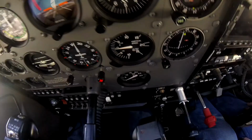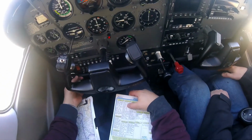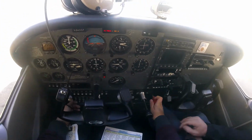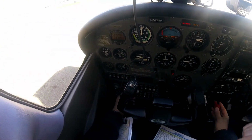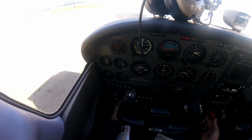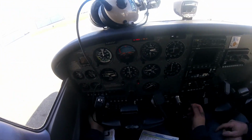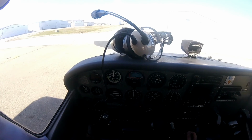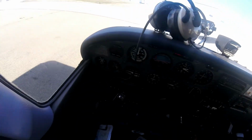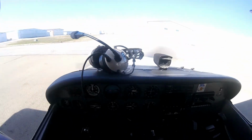So, where's the fuel pump switch? Right down there, this one. So, we go until it reads. Then you gotta go rich. Go full rich to prime it. Watch the needle come up. Little rise, give it time. Watch the throttle when you do it. Now pull the lean. Shut the pump off. Okay. And get ready to put it back rich again. Engage the starter. When it fires, go rich. Little rough. Pull back the lean. Go again. Adjust to 1,000 RPM.